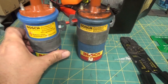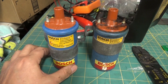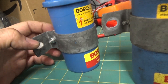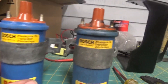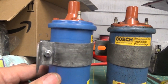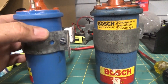Before I put it in, I did notice that the strap is a little lower on this one, so I'm going to move it up to match this one right here so it's in the exact same position as the original. How you do that is there's a little adjustment screw back here and a nut — just undo that and move this up a little bit. I've got it pretty much dead even with where the original strap is. There's the part number: 10152. This was purchased at DMC California.